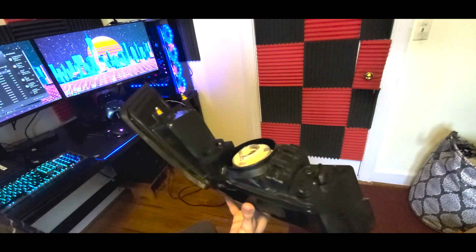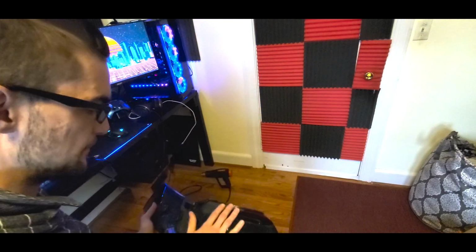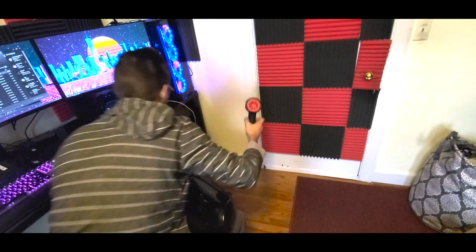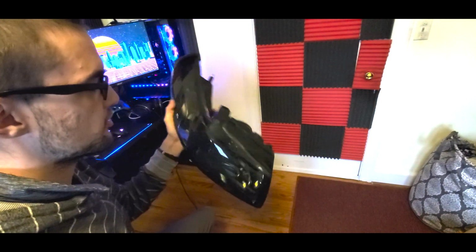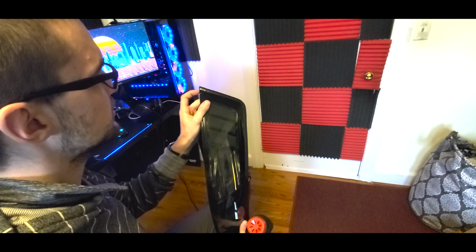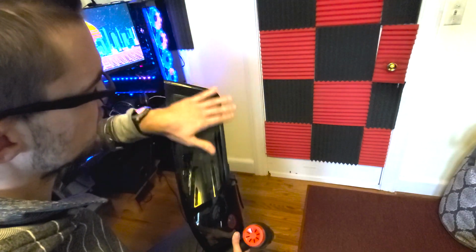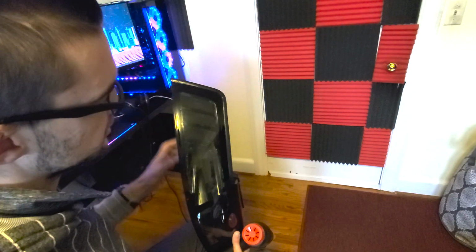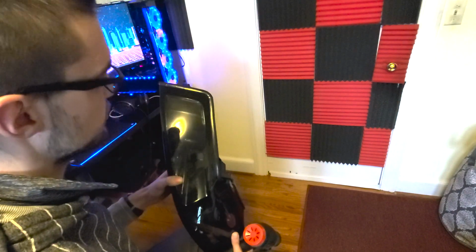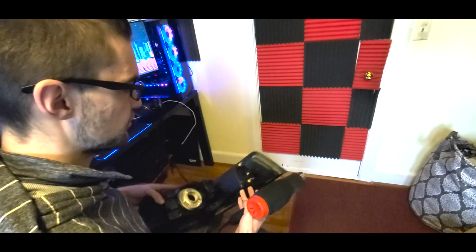I think my oven is too small anyway, because these headlights are actually pretty wide. The way we're going to do this is use your heat gun right here, and we start on this side. Now, this headlight is already broken a little bit, I got this one super cheap on Facebook Marketplace. We start on this side, heat it up so we can pull this side off. First off, I'm going to try to get this rubbery thing off. When you use a heat gun, it is very easy too. And then we will see further.